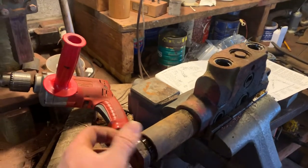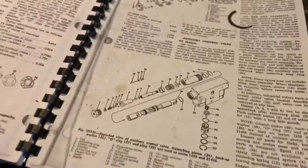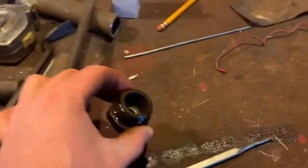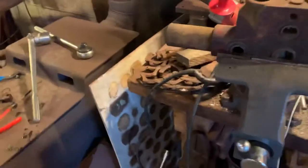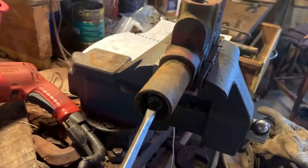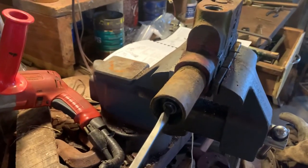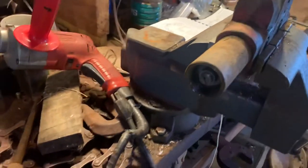Everything that I figured out, I figured out just by looking at the book. The book gives a nice layout of your valve, so I'm going to lay everything out in the same exact way. Next, which is nice and clean in here — the other one didn't have that cap so it's really dirty. I'm just going to take a screwdriver and unscrew this. But I want to be mindful — there's a spring, which is this spring right here.